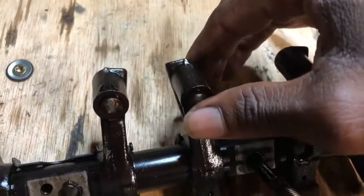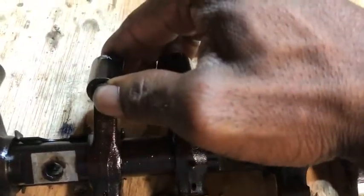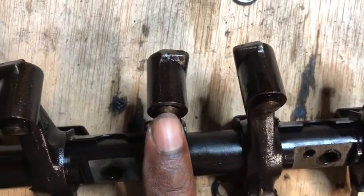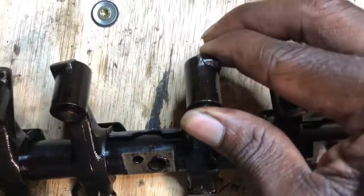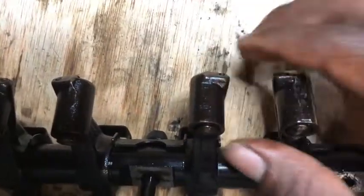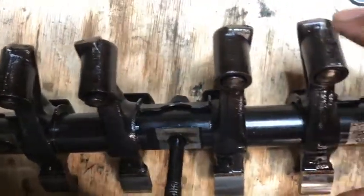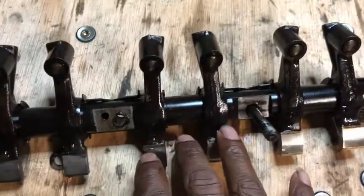As you can see, these little valves — this one is nice and spongy, but this one is too tight, dead flat. It's not supposed to be like that. So this is a dead rocker arm — see that one is nice and spongy, this one is really stiff. You can feel the stiffness. Nice and spongy, dead — no movement at all. It's supposed to be spongy because the spring on the inside is shot.